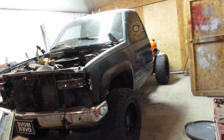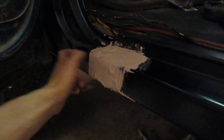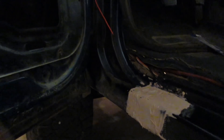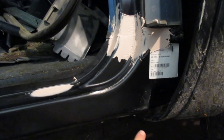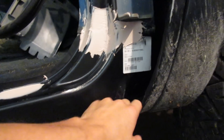We're going to be painting the whole thing and we got a new bed for it. On this side we did the cab corner and rocker panel — we opted to splice in the rocker panel just because everything up here is solid and we didn't want to remove the fender if we didn't have to. The other side is different. The passenger side had rust way up in the corner, so I cut it out, and then it decided to crack all the way up behind the fender — which is why the fender is unbolted and pulled out to fit the new rocker panel.